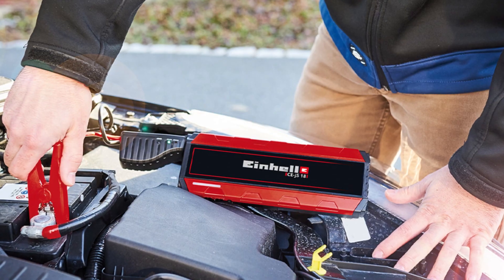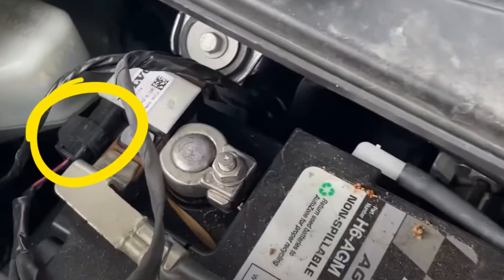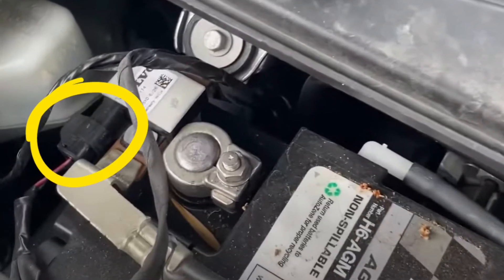But if the batteries in your car are over four years old, it makes sense to just replace them. If you do this on your own, make sure you disconnect the BMS sensor and also drive for some time after you install the new batteries to get rid of the start-stop warnings that you may get.